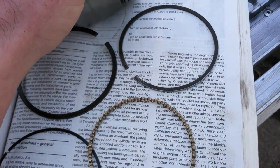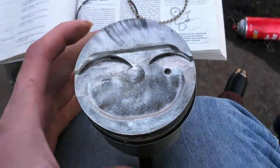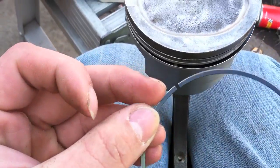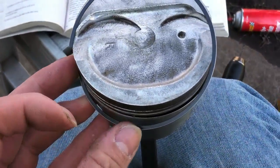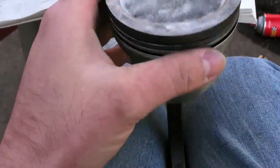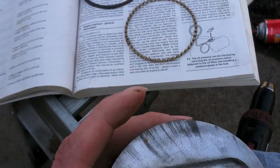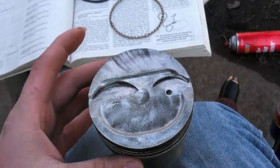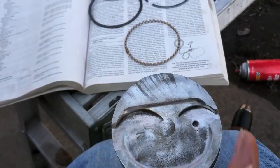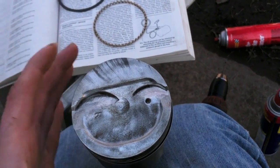It's easier to put the rings on with your hands. Push the bottom of the ring into the groove, be careful not to spread them apart too much — just work them down nice and slow into the area they need to go so you don't bend or stretch them, because they will break very easily if you expand them too much. Once you get all the rings on, rotate the gaps to the orientation your manual specifies so no gap overlaps, which would allow compression loss or oil through.